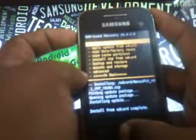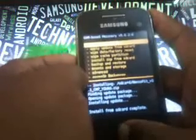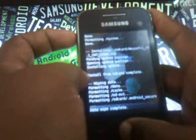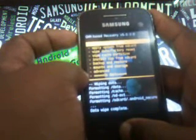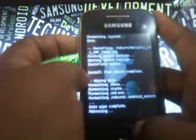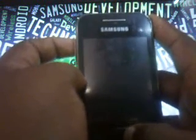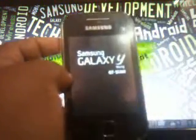Select the go back button. Now select the third option, 'Wipe data/factory reset', and select yes. Once the data wipe is completed, you can reboot the system — select 'Reboot System Now'. Now you can see it is getting rebooted. The booting also takes some time, so please don't panic. Just keep patience and wait until the phone boots successfully.